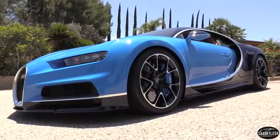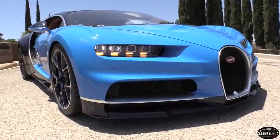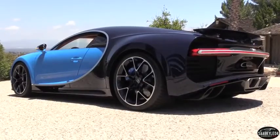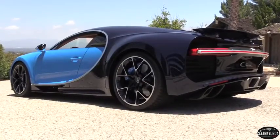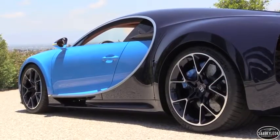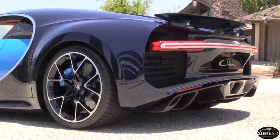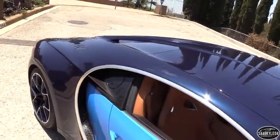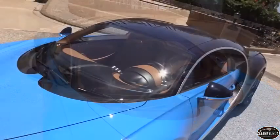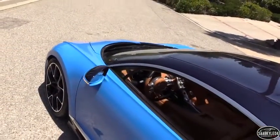The Chiron is built on a rolling chassis concept and features a redesigned carbon fiber monocoque that takes about four weeks to produce. The rear end of the chassis is also made from carbon fiber, unlike the Veyron's stainless steel structure, helping shed 8 kilograms or 17.6 pounds of weight. It's attached to the monocoque by 12 titanium bolts. Carbon fiber also makes its way to the flat underbody and many other components throughout. With a torsional rigidity of 50,000 newton meters per degree of twist and a bending resistance of about 0.25 millimeters per ton, the Chiron has a level of stiffness comparable to Le Mans prototype race cars. Weight remains similar to the Veyron despite being a larger car thanks to all the additional carbon fiber.